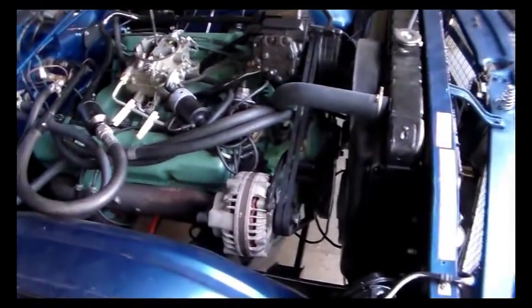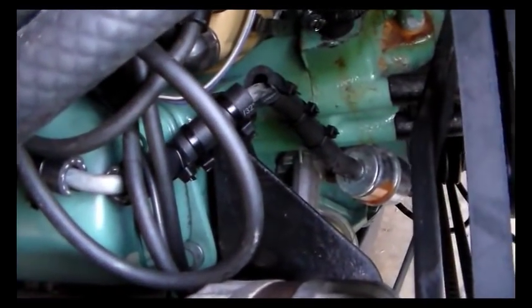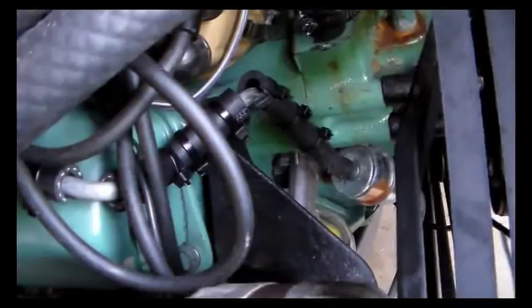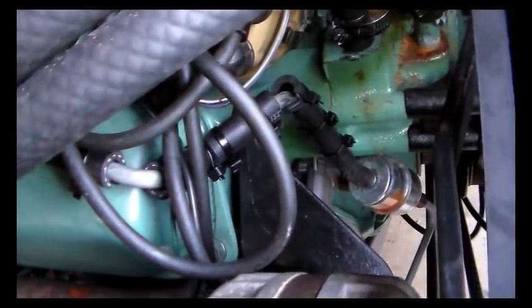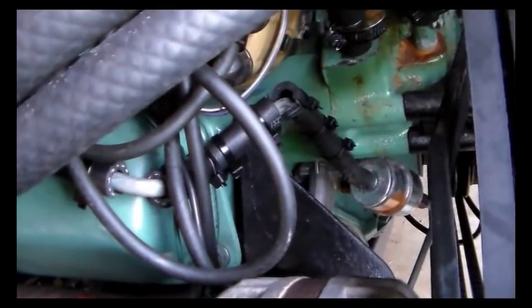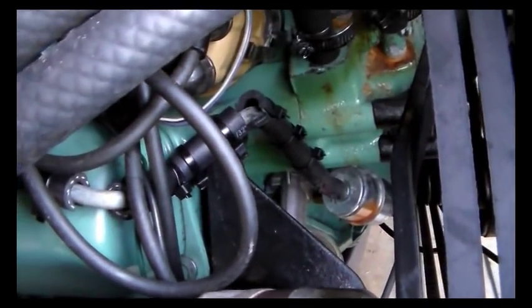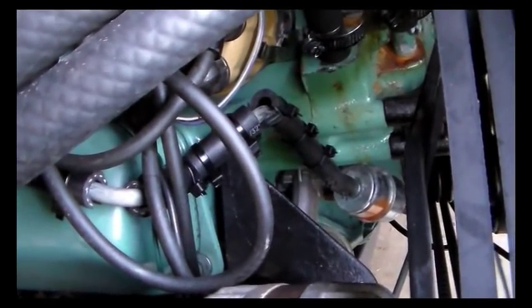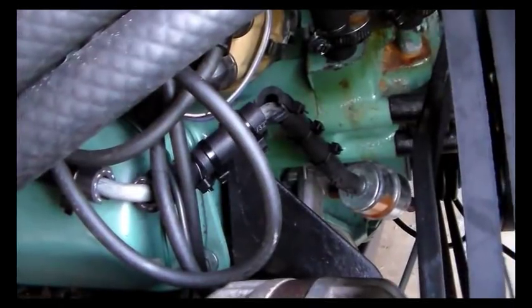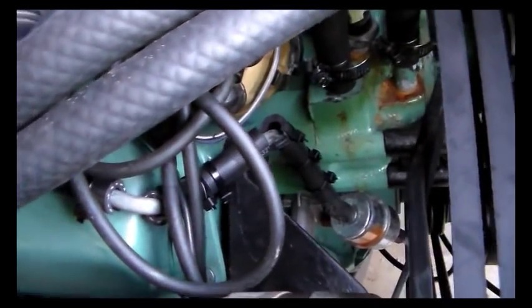So that's on. Fuel line's back together, and I insulated this fuel line with some home things I had, which means a piece of fuel line that is split, and I did the best I could with it. It was against the engine, so there are still some spaces in it, but that fuel line will not bend that sharp. So we're going to try that. If that doesn't work, we'll have to go with something else, if it doesn't have the desired effect.